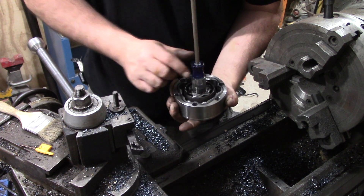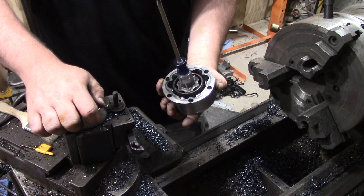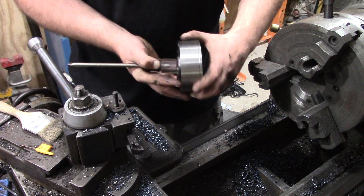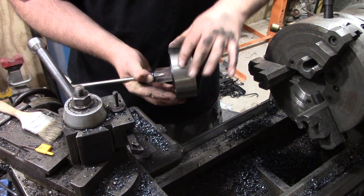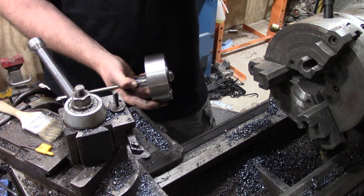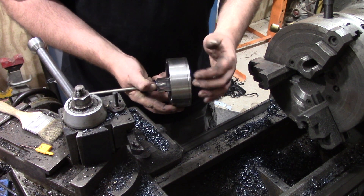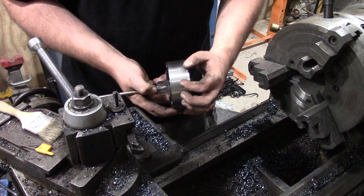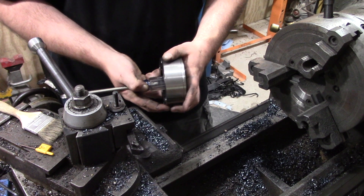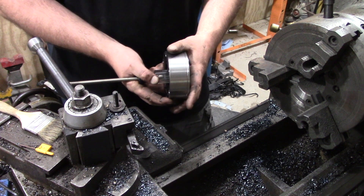The reason I bring this up today — it's a real short video — is I've been trying to find a solution for the axles for the race car. Once you go to something that will support Porsche 930 CVs, you have an enormous world of options: lightweight joints, non-vented, finned joints, high-strength joints, race-prepped joints, joints made for operating in saltwater. It's literally the CV joint that has the most options to it.